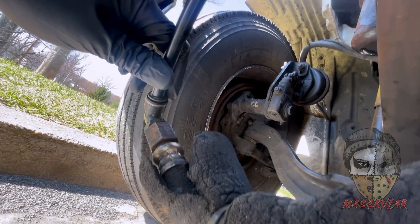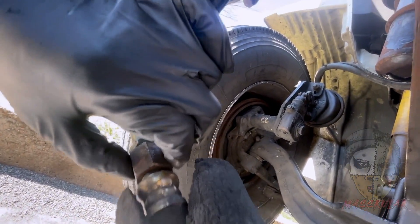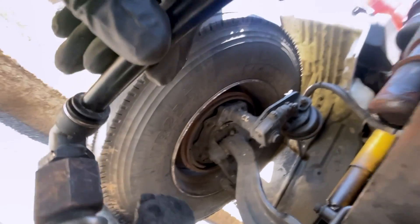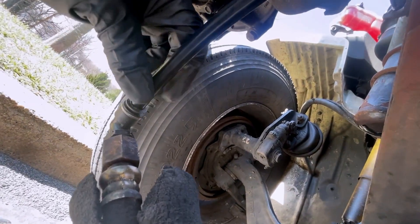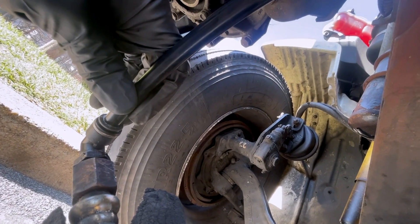Basically trying to eliminate whether it's the air dryer or not. I disconnected this big one from this fitting right here, and then this black fitting — a 90-degree — that was plugged into this right here. I just connected them together and see if I'm still having the same issue, which I'm not. So that isolated the issue to the air dryer.